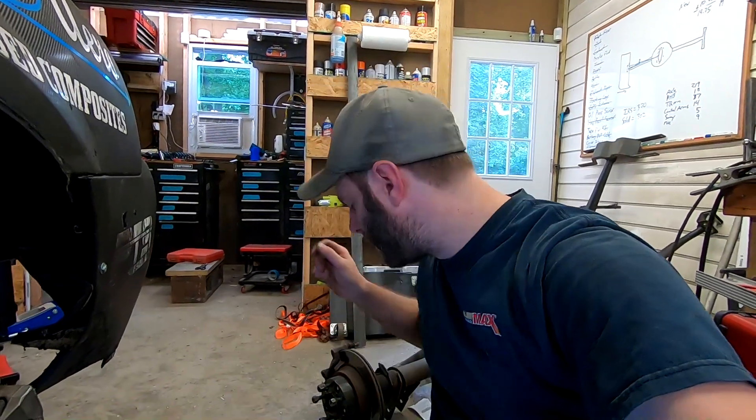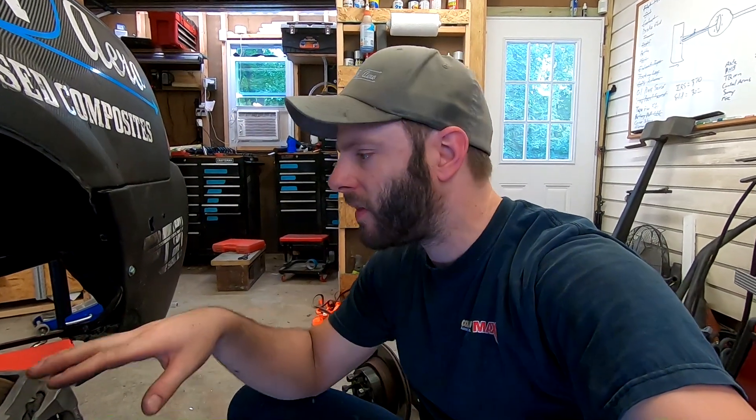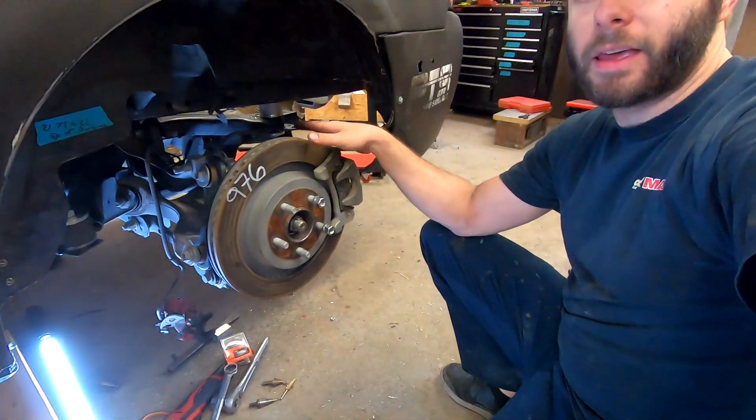I should be able to make a bracket on the control arm to get the shock to work. I'll need to look into wheel rates because the formulas to calculate them are different between a solid axle and an independent rear suspension. The leverage ratio across a solid axle versus the pivot points of a control arm are totally different. That's stirring around in the back of my head. If you're watching this with a million questions, so do I — I'll figure them out as we go.